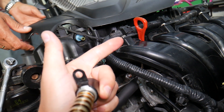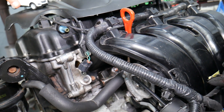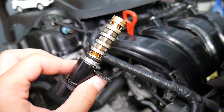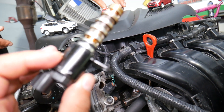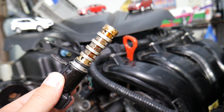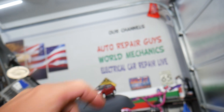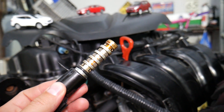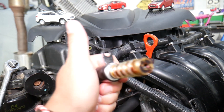Things that can cause these codes are: dirty engine oil, engine oil that hasn't been changed, low level of engine oil, or using the wrong type of engine oil. Having a defective engine oil filter can also restrict oil flow and affect it. The most common cause is a faulty or dirty VVT solenoid. Nine out of ten times you can clean it and save it — we have a video on our channel on how to clean it, and also a video on how to test the VVT solenoid to find out if it's good or bad. Those are the most common causes for codes P0075, P0076, and P0077.